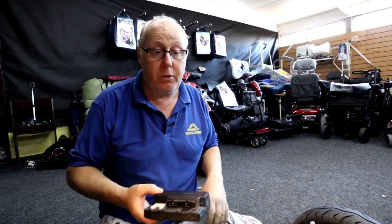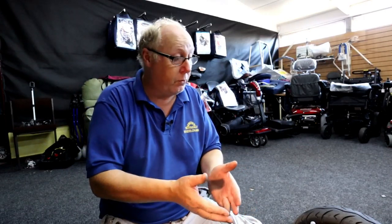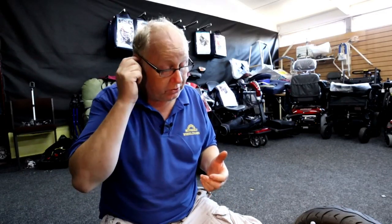These controllers can be quite expensive as they are the main power module, and of course the motor will be expensive too — it's a heavy-duty four-pole motor. I'm going to speak to the customer and see what he wants to do. I know for a fact he doesn't want to spend a lot of money, so I reckon he's going to tell me to just change that terminal inside there, and then it may work or it may not. Short video — we found out what the problem was very quickly. It's not usually like that; sometimes it's more difficult. The burning is a key sign.